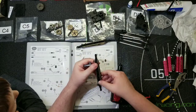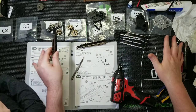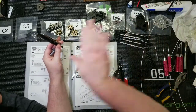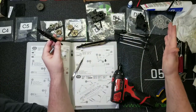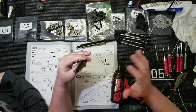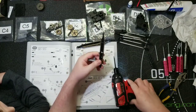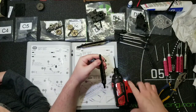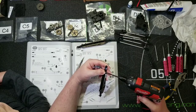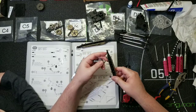It's to make sure the head kind of smushes out from the center, because if you put the bolts on the outside and it's bowed like this, and you put these bolts in and it locks it in place, and you go tighten the center ones down, you're warping the head. It's just me being anal retentive is all of this, from years of working on cars.